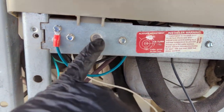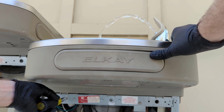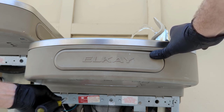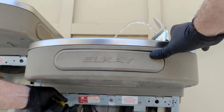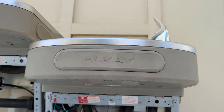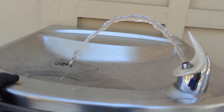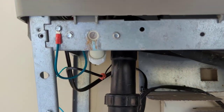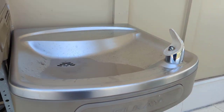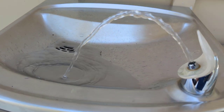I'm going to get my screwdriver and show you how to adjust the height. Watch the water height change — if I turn it counter-clockwise, you can see it going down. I'm going to turn it clockwise and we'll increase it, which we're going to leave it right about there. You don't want it too high, otherwise it starts splashing. That one looks pretty good too, so I'm just going to leave them right where they are. I just got to put the covers back on and these water fountains are good to go. Thanks for watching and I'll see you on the next one.